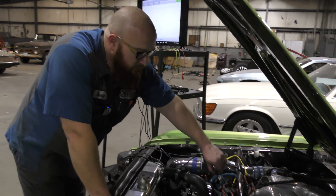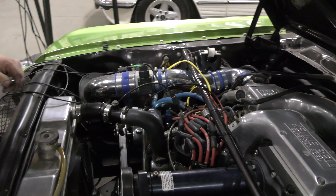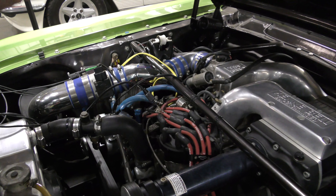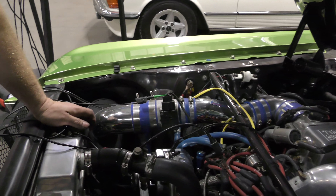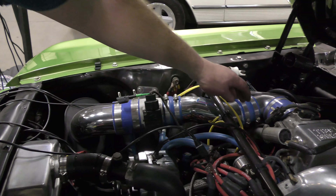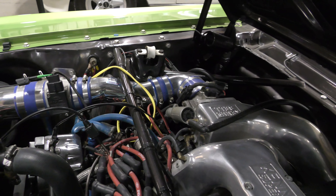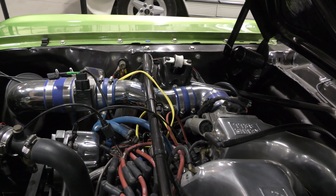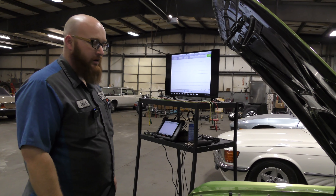I only have a few sensors hooked up just to show you guys what it looks like and how it works. I have this little inductor that can see ignition through the shielding of the spark plug wire — you can kind of see it firing. We've back-probed the mass air flow sensor, and we've also got a little pigtail hooked into an injector so we can look at the signature off of one of the fuel injectors.